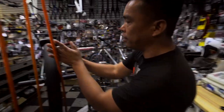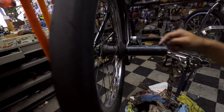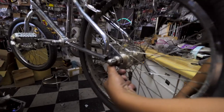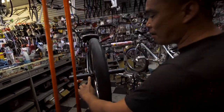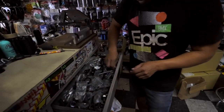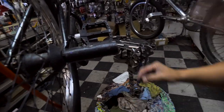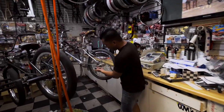If I was to take this wheel and put it over here, it won't work. Some of you guys go, 'Obviously' — the axle size: even though it has pegs, it's 14mm, it's thicker than this 3/8. The dropout on the old frame won't work. But this new wheel will work over here because the dropout on the new frame is 14mm. So keep in mind: 3/8 versus 14mm. We have little reducers — put the reducers in those 3/8 dropouts so they slide into the 14mm dropout. No problem. So the old wheel goes on the new frame.